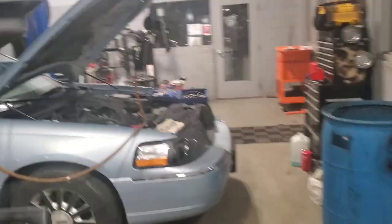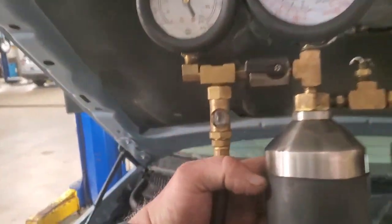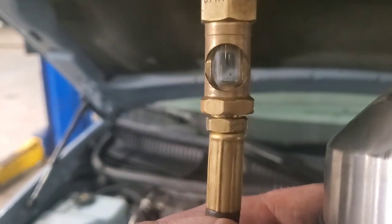When you have startup pressure on these it's about 51 to 52 psi, but after it stabilizes it comes down to about 38 to 39 psi — that's normal, so that's why I set this right at 40. Let's go check on the car. Still got fuel in there, got a little bit of a leak but I'm alright. Once I start to see bubbles inside here I know I'm about to be empty. I heard it hesitating so I ran over and shut it off before it died completely — no more fuel in there, it's dry.